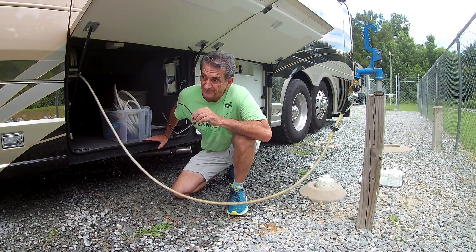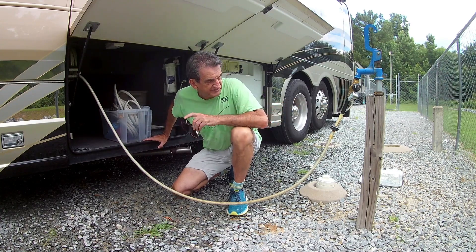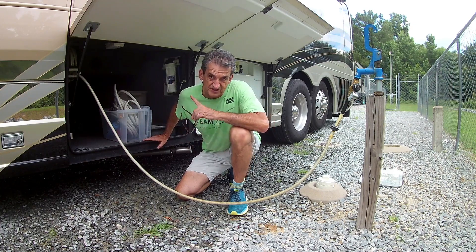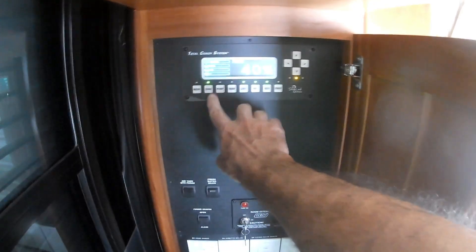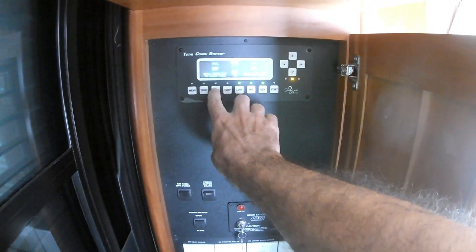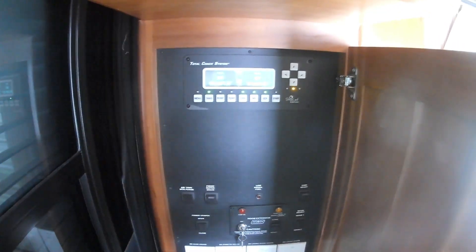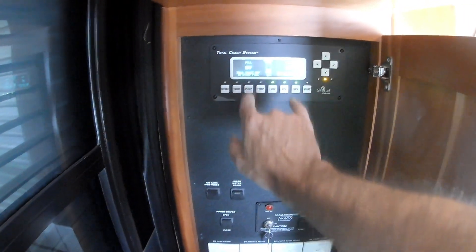I was just inside — I can use the toilet, run the sink, some water is running fine. So right in the campground, just connect the water. Do not activate the pump; there's no need to run the pump and there's no reason to run the water fill. I'll show you inside what that looks like. Those are the tanks, but my water fill and my pump are off. When in the campground on city water, I don't need to run the pump nor the water fill.